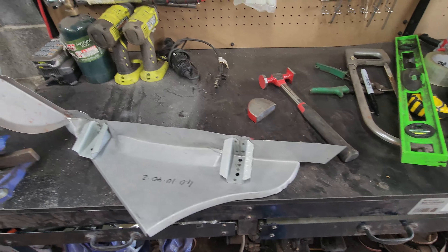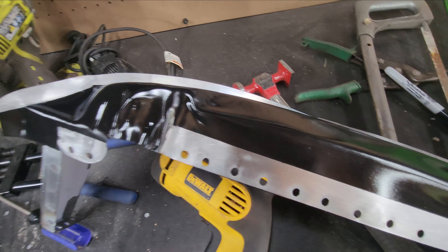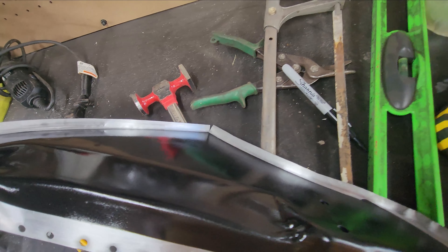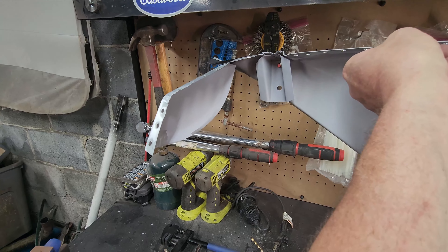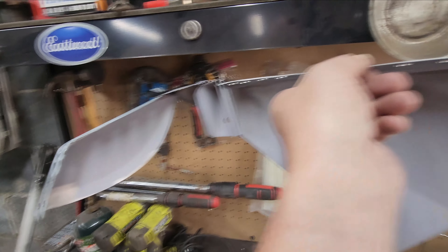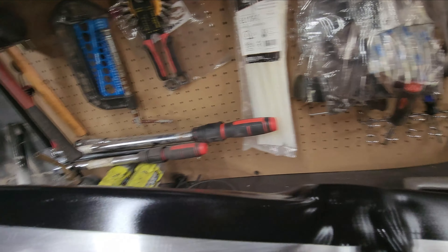Let's get this thing punched and we might try to get it fitted tonight. Alright guys, back — got this thing all punched out and painted. Got this side black, and I know it's not the color of the car but you'll never see it — it's up against everything else. It's basically just to keep it from rusting underneath there. Then I primered this side, which — I just noticed I forgot to tape the bottom of that thing. The bare spots are for the spot welder and I forgot to tape that side off, so now I gotta sand it off.